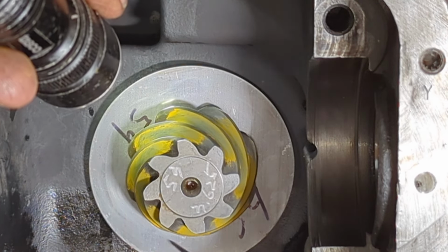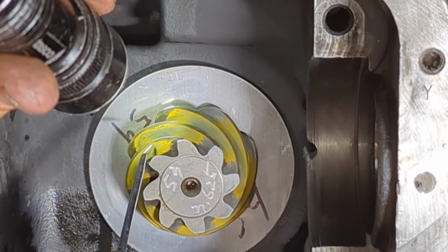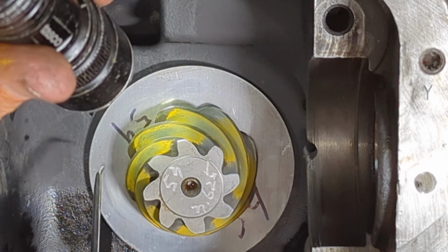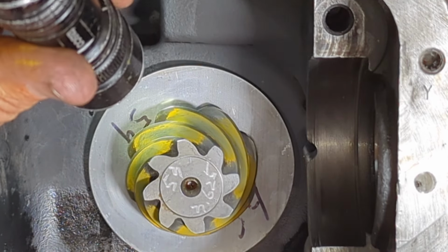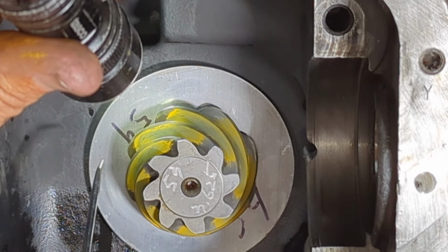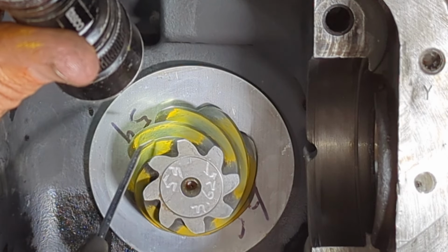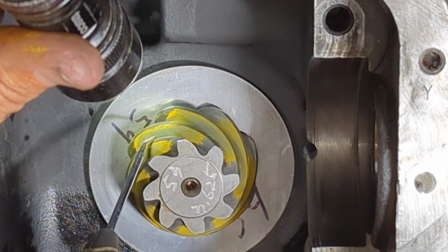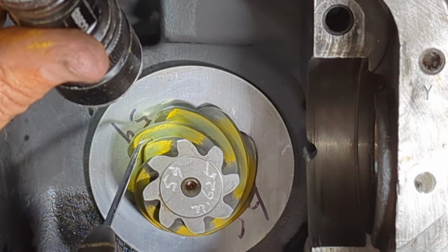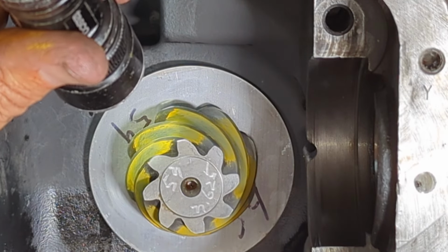So when you look at the pinion head from straight on, you're going to see another pattern that's going to match the one that's on the ring gear here. What's very apparent is when you're either really shallow or really deep. But since we're very close right now, it's starting to look like it's going to be a runnable pattern. When you look at the pinion, it will paint opposite of what you think. So you see how thick this line is here? On a ring gear, that would be telling me it's a little bit deep, but it's the inverse when you're looking at the pinion. That means it would be a tad shallow if that was a really thick line down here. So it would be just the opposite of the way you would read a ring gear.